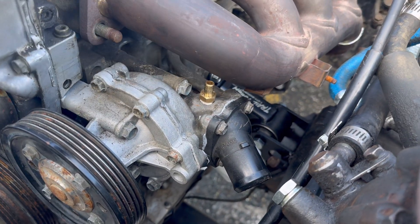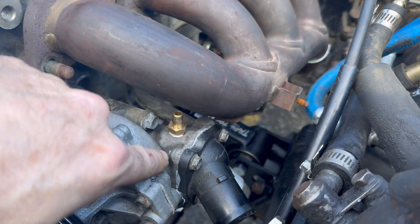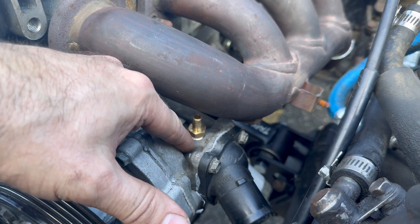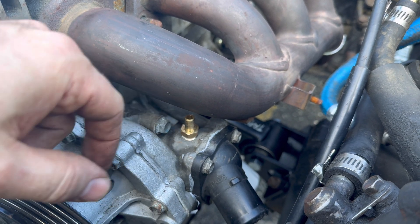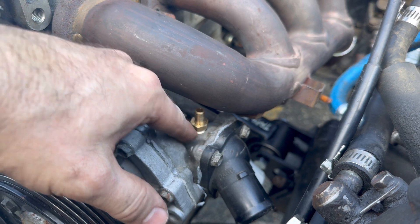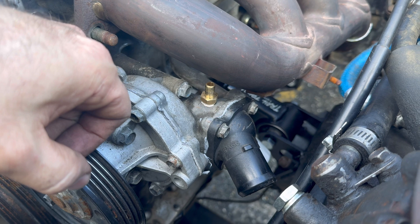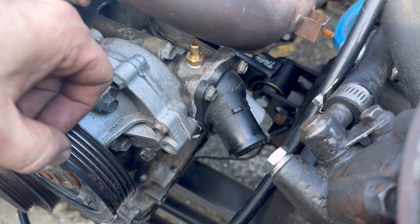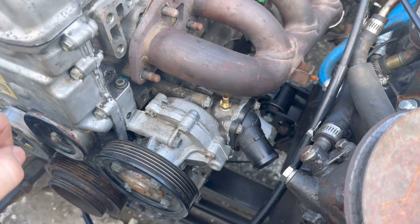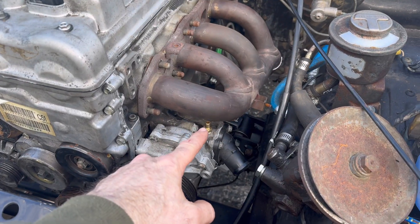One thing with this header that I don't really like is this coolant line that we tapped in there — it's going to hit the header. Kevin said I should go a little bit further forward and drill it so it comes out more this way. I'm not opposed to doing it on the bottom, though I don't know if that's going to be good or bad. I need to address that because using this header it's obviously going to hit there.